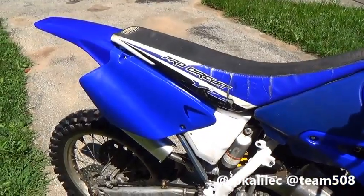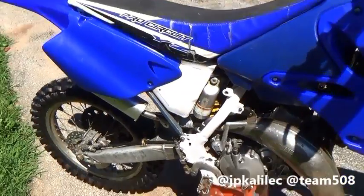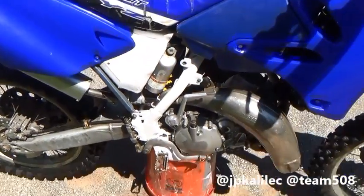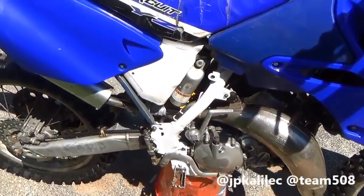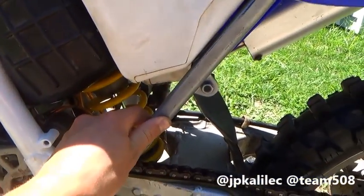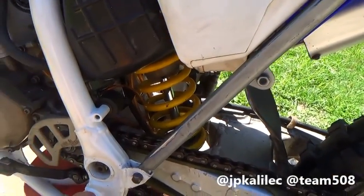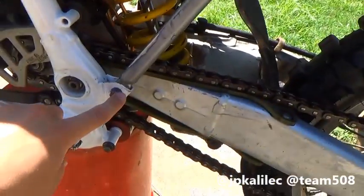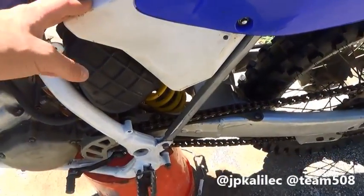If you're going to do this conversion, you're buying basically half a dirt bike. I would not buy OEM brand new parts — I would buy used on eBay or Craigslist and patiently wait for new listings to pop up. Price-wise, this subframe was $32 on eBay. When you get it, it won't seem like it's going to fit at first. You hinge it on right here, slide it down, and sort of bend your way onto the mounts — it'll fit eventually, there's a method to it.